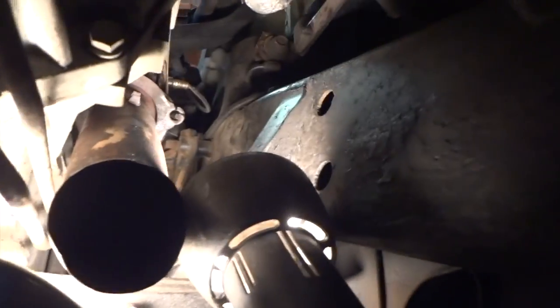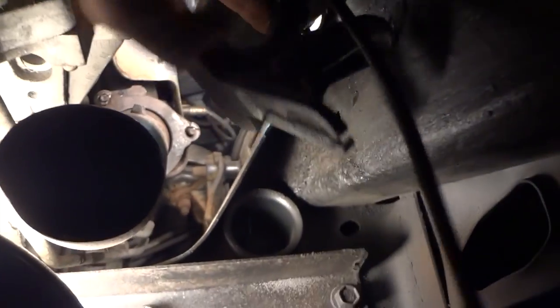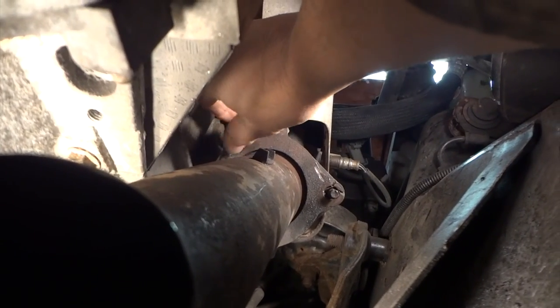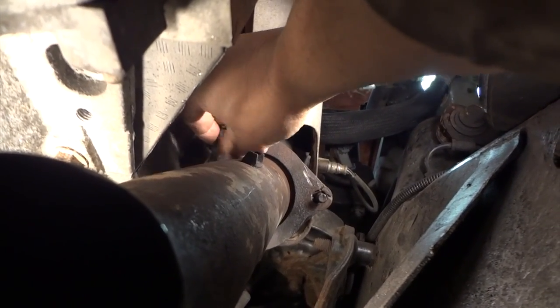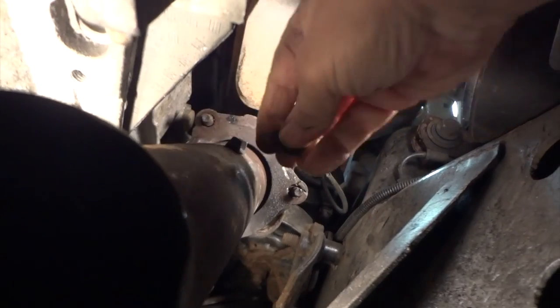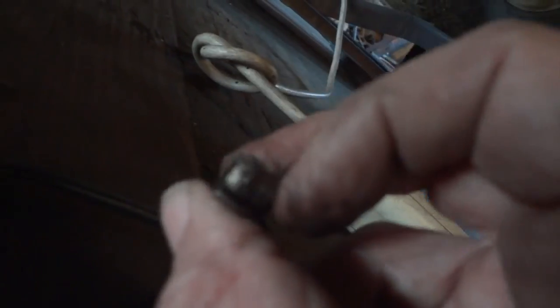So what I'm going to do is stick my hand up in here — bear with me a second. We're going to get this nut off on the top, which is at a weird angle and kind of hard to get to. I did all the work off-camera. It took me probably an hour just to get this because I didn't want to damage the threads too much. I still got threads — there's our nut. Take it off and look at it here. See, I cut a good slice into it, and that's how I got it off. You've got to judge your wheel right up against that stud to figure out exactly where it's at. Even if you do damage the stud a little bit, the threads aren't going to hurt anything.